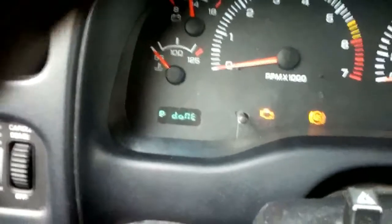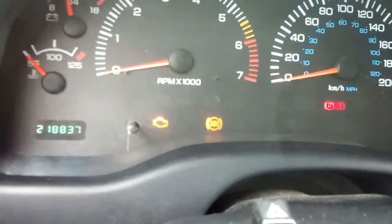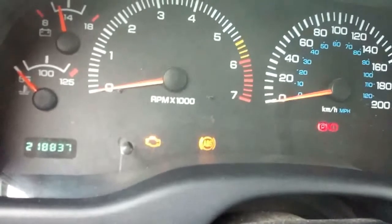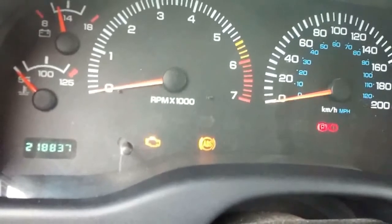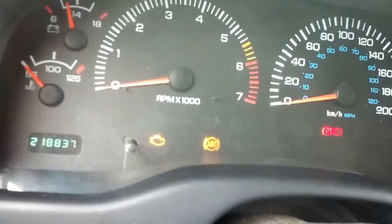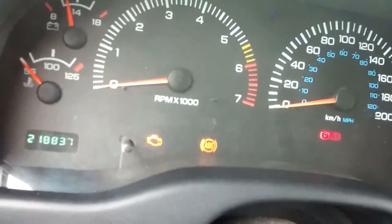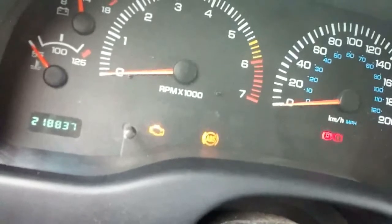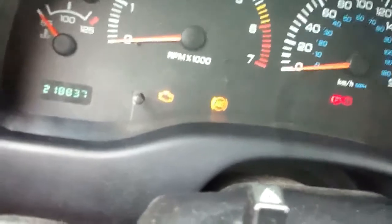Apparently that's it. So we have three lights and two codes. One of the codes is going to be for a speed sensor, because when the brake and ABS light both come on at the same time it's usually a speed sensor — one problem can cause those two lights to come on. I'm going to Google the error codes specific to the vehicle, like '2000 Dodge Dakota P0445,' and what I'll find is that the other code is for an evap leak. So this truck is going to need a speed sensor and it's got an evap leak.